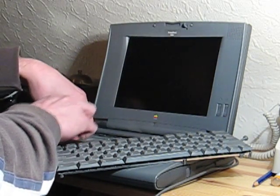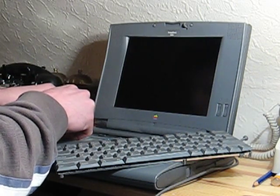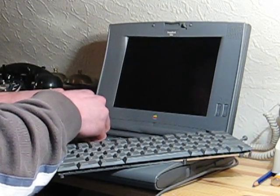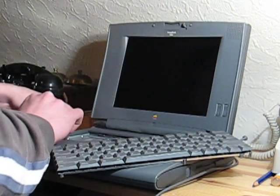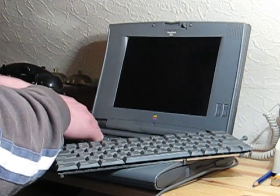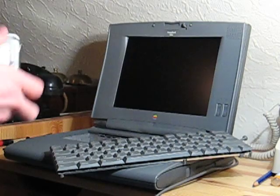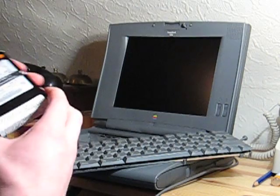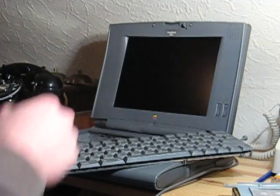It's a little fiddly, this, actually. What I'll do first is use this small screwdriver to prise the hard drive cable out of the drive itself, hopefully. And then very gently... Anyone who's done this will know just how fiddly the compartment is. So that's it — that's the internal PowerBook hard drive, SCSI, actually taken out now. This is a 160 megabyte drive. No hard drive in the machine.